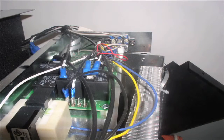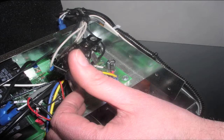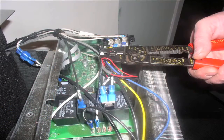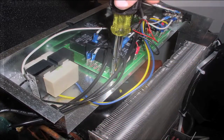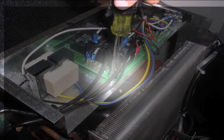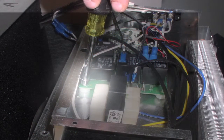The first step in removing the control board is to remove the terminal block — that black part visible in the photo here. Remove that entire terminal block. Next, use your wire cutters to cut the plastic zip tie so that the wires can be more easily moved back and forth. Once that's done, remove the screws that hold the board to the panel — found at the corners of the board — so the entire panel can gently move out of place.